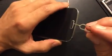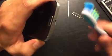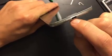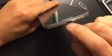If you're scared to use a metal pin, then maybe get a toothbrush, guys, and clean it in there. And then pop the battery in and pop your cable in if you have issues with the cable and stuff like that, and see if that resolves your issue. I'm hoping one of those fixes will resolve your issues for you guys, and if it doesn't, then you may have to replace the dock port here, which, like I said, is under $10. It's really easy to replace.